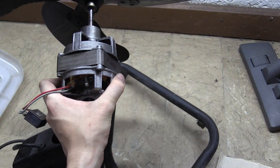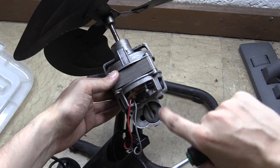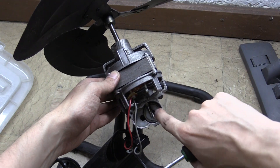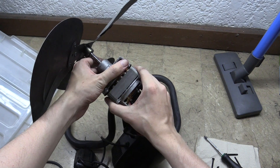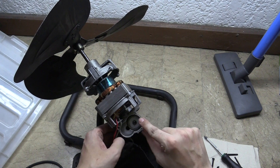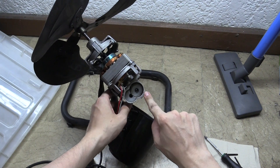It's basically not working and I've already worked out why. To show you, I just have to open up the motor so we can move the rotor forward and get access to this gear. Now I've removed the screws — we can pull this whole rotor forward, kind of separate the motor apart. Now we've got better access to the gearbox.